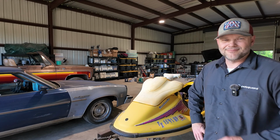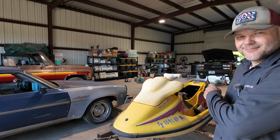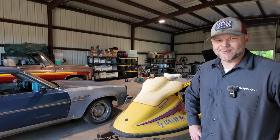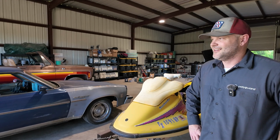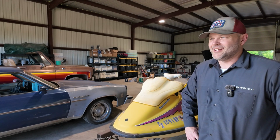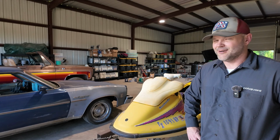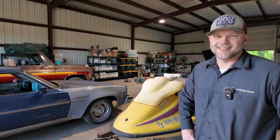You know, if anything, Polaris Ranger plus El Camino is greater than whatever silicone sealant they used on the back of that pump housing, because that thing was on there. And that Ranger, I put in low gear. Jeez, whoever did it right. I mean, I might have even done it. I might have done it in my sleep and not remembered, but jeez, whatever you do, put the most amount of RTV you can on your impeller housing.